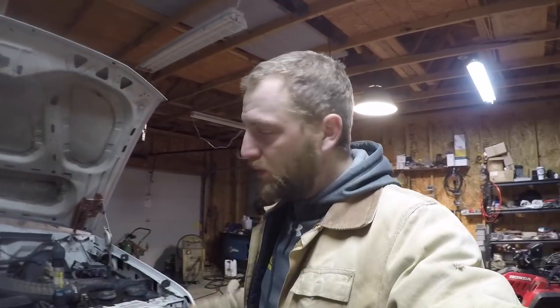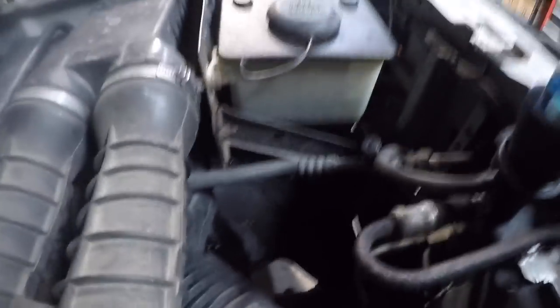I've been at this for several minutes now, and as you can see, our fluid is just as nice and blue and clear as when I poured it in there. So, at least according to this tester, I don't have a blown head gasket — that's really good news. But it leaves me wondering: if it's not a blown head gasket, why is this truck puking antifreeze out the coolant reservoir? It's obviously something not working out, so we're going to have to figure that out. That'll be in another video coming up, and the transfer case repair will be in another video coming up soon as well. Subscribe if you guys want to see that stuff — thanks for watching, and more later.